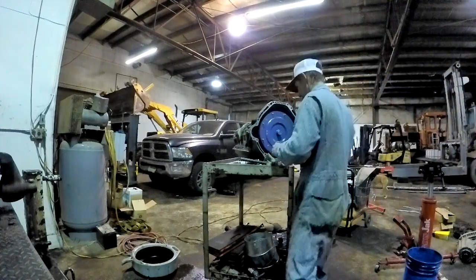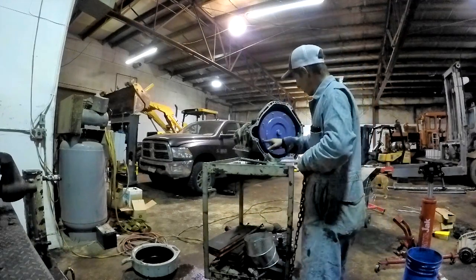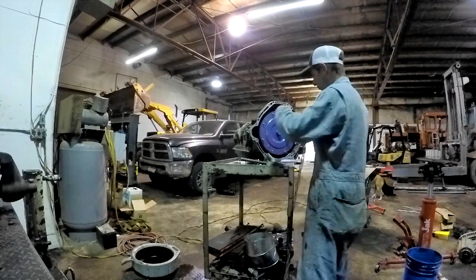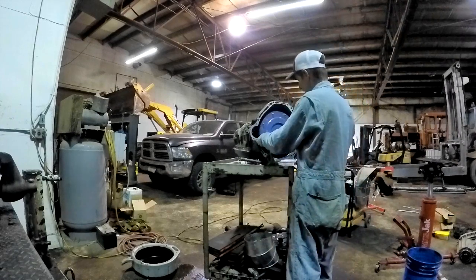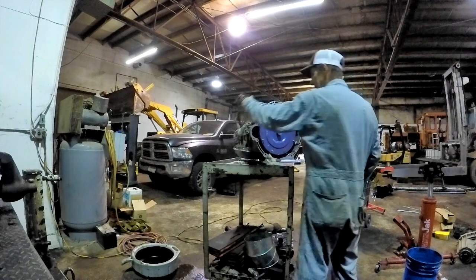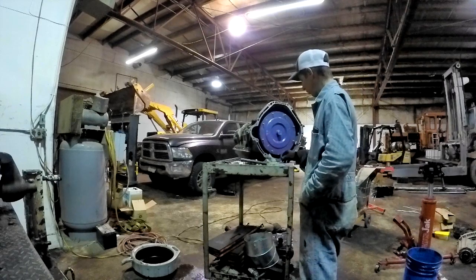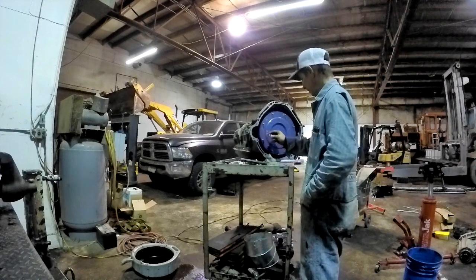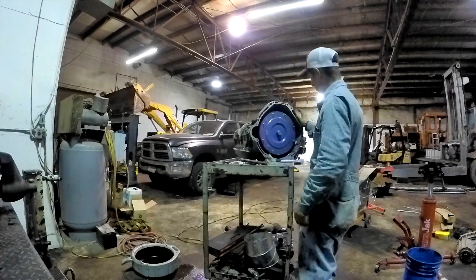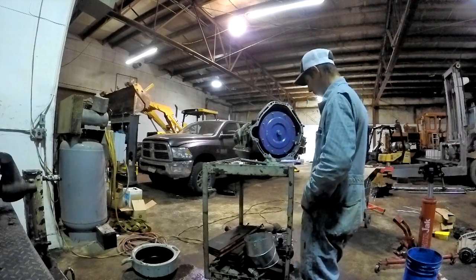I can't get a chain on it. I had that little chain here somewhere. If this converter had threaded holes in it instead of the studs, I could just stick this chain on here and anchor it somewhere and pull on it with a come along or something to pull it out. But I can't really do anything there. I'm thinking I'm gonna have to take a piece of metal or an angle iron and drill a hole in it and slide it over the stud, then put the nut on it and then weld some chain to the angle iron and hang it off the crane and hit the bell housing with a big rubber mallet with a block or something to try to get some bits to come out of there.